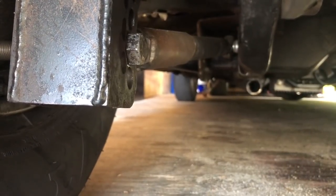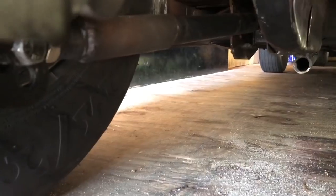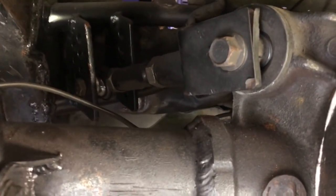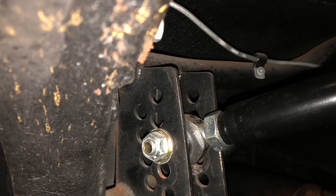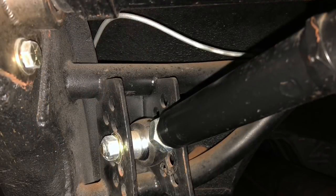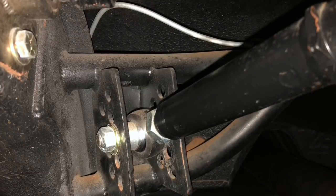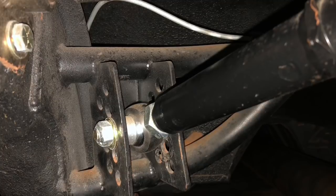This is an example of lower control arm bar angle — it rises from the rear to the front, about one inch. Generally the lower bar needs to have a slight uphill rake. The upper control arm is pointed downhill from the rear end. This is a picture of the upper control arm mount with lots of holes for lots of adjustability. To find your instant center location, you must continue the angle of the bars and draw an imaginary line from the upper bar and the lower bar out into space. The point where those two angles intersect is your instant center location.